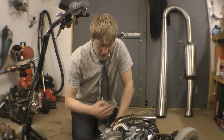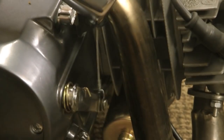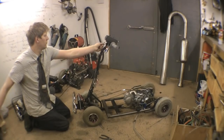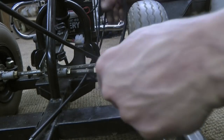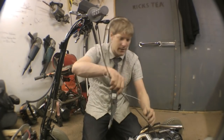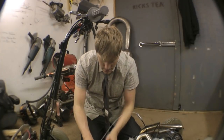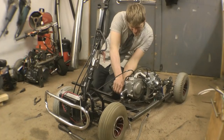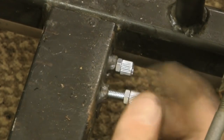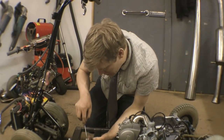Hence I got too close and melted a cable. Same with the clutch: put the clutch cable onto the engine, stick the twist grip and clutch lever on and weave them through the frame. We've got two cables from the engine and two cables from the controls, and we need to join them together in the middle by drilling holes in these little brackets, putting some little adjusters in and clamping them together. To join the two cable ends together, just use cable connectors.